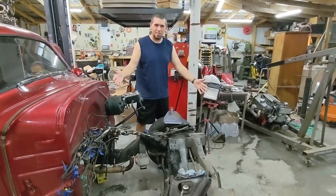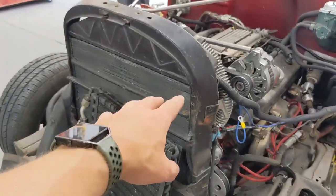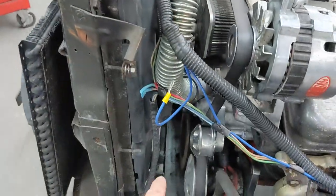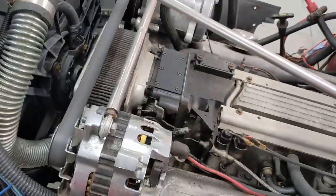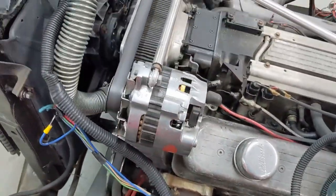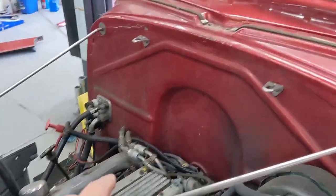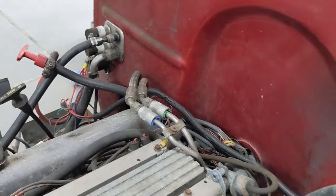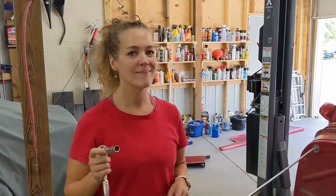As you can see, we've been a little busy, so let's get into it. Work today is going to be disassembling this entire front end all the way down. We're going to drain the coolant. I want to try to get all of this out through here — some of these high pieces like the alternator and compressor. You can see in this body style how up high and tight they are just to fit where they're supposed to live. We're going to work on getting into this direction, then maybe work on some of the wiring harness. The fuel is still hooked up — we've got to get that out, make sure it's not pressurized. At some point we're going to drop the tank and the lines for the welding and the rust repair we need to do.